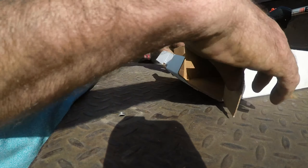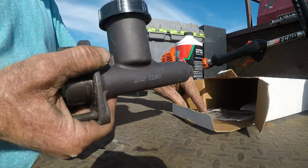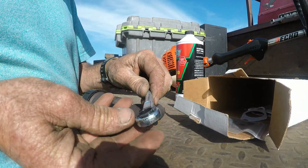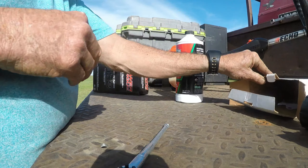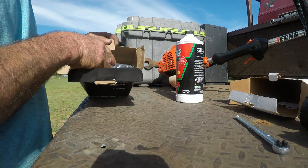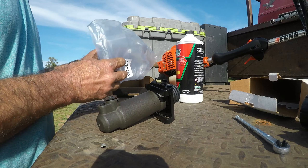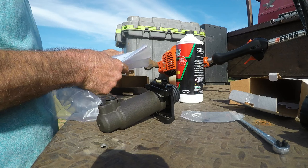It's done this before when I first got it running — it was a little clip that holds the rod on that had come loose. But I don't think that's the issue this time. When I crawled underneath, the slave cylinder was destroyed, leaking really bad. So we're going to have to bench bleed this and replace it so I can use my clutch again.